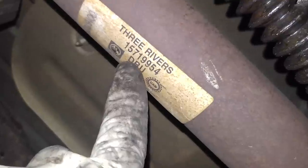I'm going to jack this thing up off the ramps and see what's loose in my steering, aside from my rattle-clang-bang-knock steering box. Pipe within a pipe — what else could it be? Nothing else is touching. That's some good Arizona red mud. The pipe pinches to go over the cross member. You don't hear it in the vehicle, but just curious. My pump's rubbed — not through yet, but I'm going to take it off and prevent it from happening. I've got to put my glasses on — it looks like rust, just mud and a light coating of surface rust.